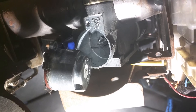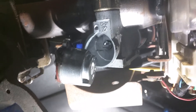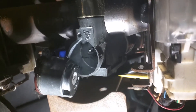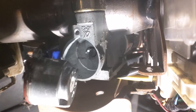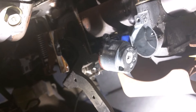You don't need any key — you can just take that and turn it. If you look inside the barrel, that's what turns when you put the key in. If I take the key and put it in the cylinder, when I turn the key, this is what happens. That's the only thing that the key does. The thing that really starts the car is just here, so if you pop this out and just turn this, you can turn the car without a key very easily.